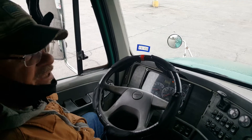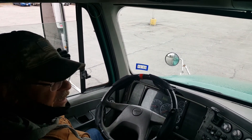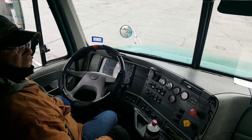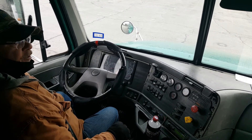Then you would move to your mirrors, which is step six. These are my mirrors. I have three on each side — three on the left, three on the right: one, two, three, four, five, six. They're properly mounted and secure. They're not bent, broken, or cracked. Not missing any bolts or screws. They're clean and clear. They're adjusted to me. No illegal stickers.